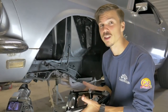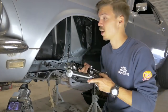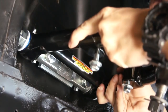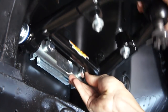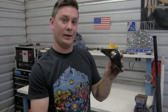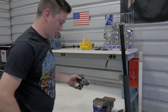Now that we've got our holes drilled out, we're going to take the upper control arm with the spacer and slide it into the holes we drilled, then torque it to 80 foot-pounds. The saddle mounts on our upper control arm are super thick, so the stock ones won't cut it — they are pressed in, so I'm going to sit it in the vise. Now I've got these just kind of tightened up a bit and I'm going to switch to the torque wrench.